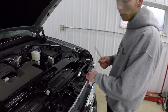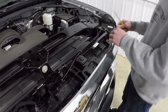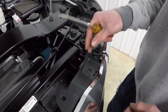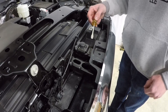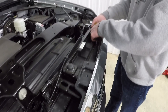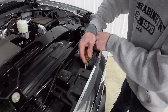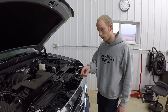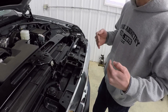You have to be really careful. You're going to want to use the flathead screwdriver for this. There are tabs on the top — little tiny tabs here. You've got to lift up and out very carefully. But the middle one has a tab where you can't lift up very hard, so you've got to put the flathead under there to help you pry it up. Once you get those tabs popped loose, you can tell that the grill will kind of pop out a little bit.